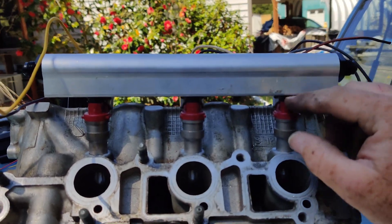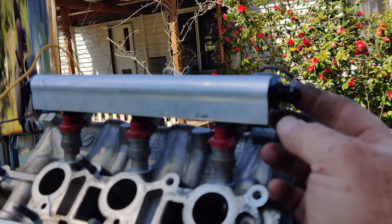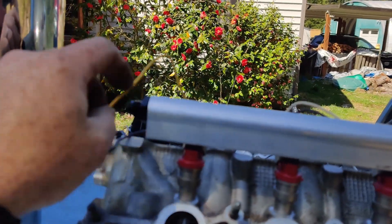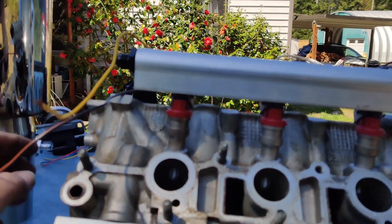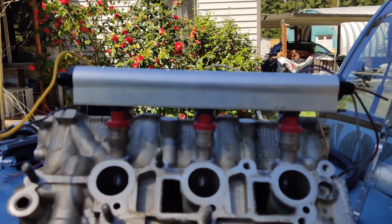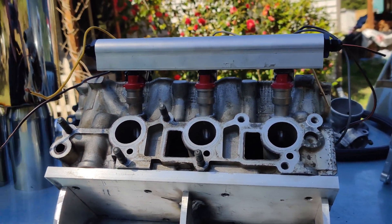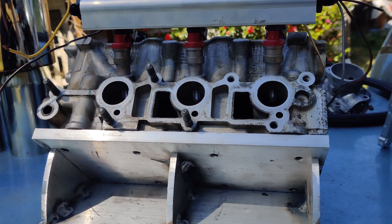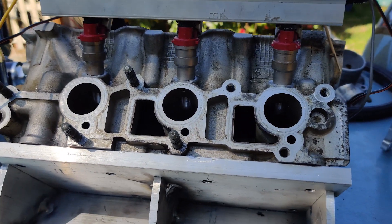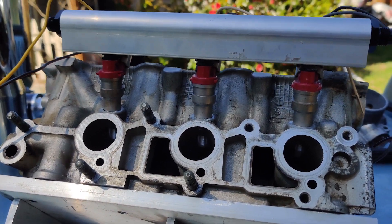These injectors have a smaller O-ring, so I did a smaller hole in the fuel rail and threaded the ends for 8 ORB to dash-6 JIC or AN fittings. I'm going to be completely redoing the fuel system from the tank all the way forward. I'll put an in-tank pump — probably just a 255 Walbro-style pump — and then obviously come up here with a return-style regulator, because the stock fuel pressure on this car was only like 12 or 15 PSI, something ridiculously low. The head is also going to the machine shop — going to get bronze valve guides, brand new valves, and a valve job, so at least I know I'm starting with a good platform.